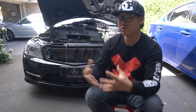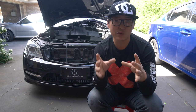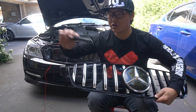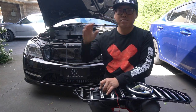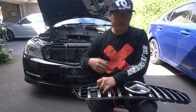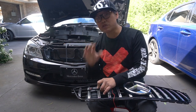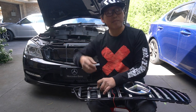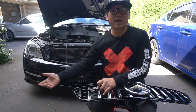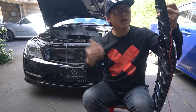When it comes to installing this, you do not have to remove the grille from the car. The only reason I've removed it is so I can show you up close how to mount it. I've decided to install it on this side to tap into my current angel eyes so I don't have to go all the way to the fuse box. If you already have a light-up LED star, just tap into that power source. If not, I'll show you how to use a fuse tap. As long as you get 12V switched power to your light source, it will work.